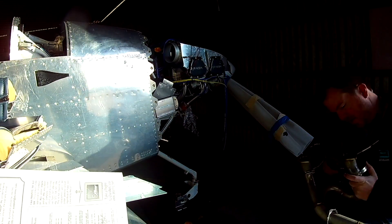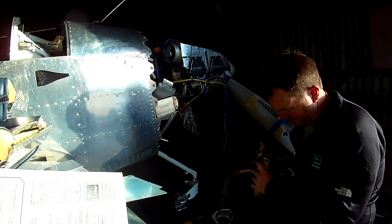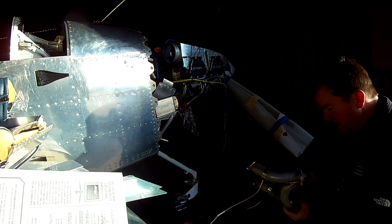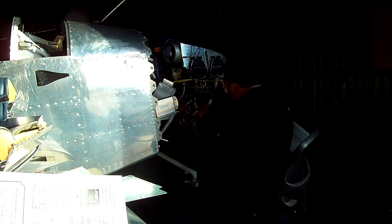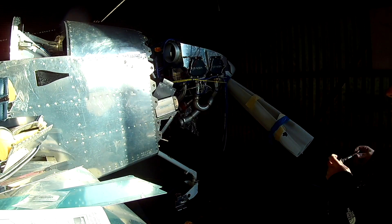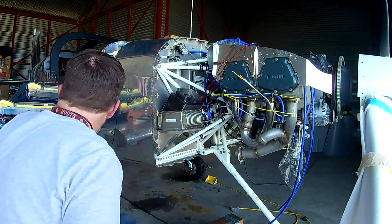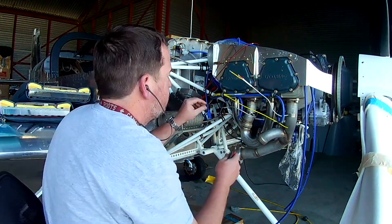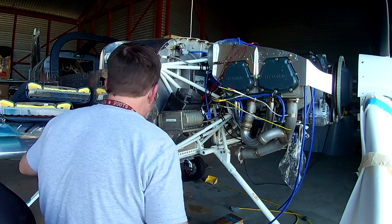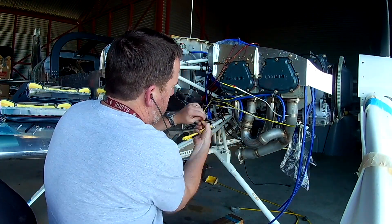These exhaust tubes aren't exactly straight — they're actually on a bend. When you drill the holes into the exhaust, you want to drill the holes perpendicular to the exhaust. This isn't about drilling in the direction you want the probe to go; it has to be perpendicular. A little bit of trigonometry is required because you may have to mount one maybe a 15th to a 20th of an inch lower because it's on a curve facing up and the tip of the EGT probe is actually going up. As you can see, they may not look identical, but the tip of each is two and a half inches from the bottom — and that's what we want. Warning: maths is required.